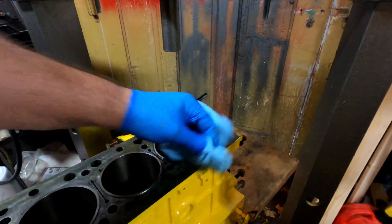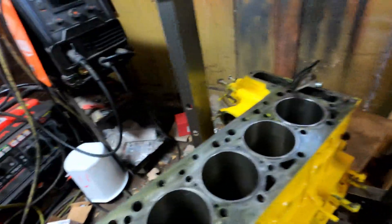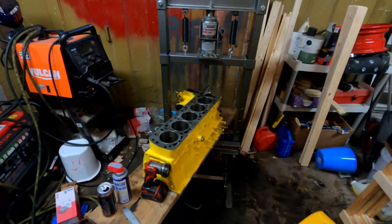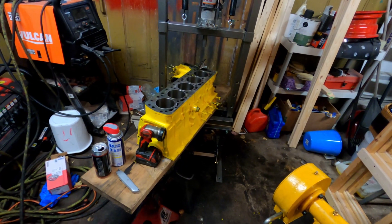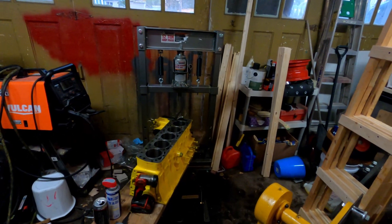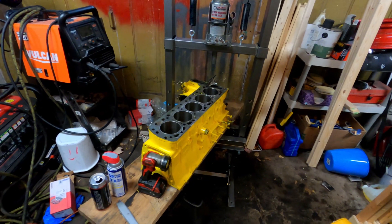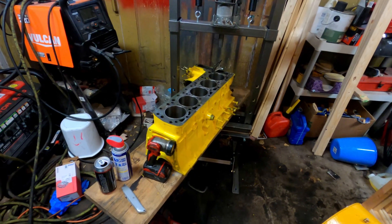According to the timer on the camera, that took eight minutes. I now have basically a brand new virgin block. According to the factory service manual, these are meant to be deck flush and not stand proud at all — some of the diesel mechanics told me that's called protrusion in the manuals. Apparently this engine is not meant to have any protrusion and it has a fire ring in the head. So I'm going to put this back on the stand. It'll probably go to the machine shop next week. I got new-to-me pistons from the junkyard, so I'll select the best five number ones out of that and take them, the balancer, and everything down and let the machine shop do their thing.